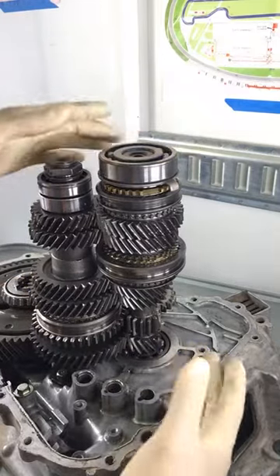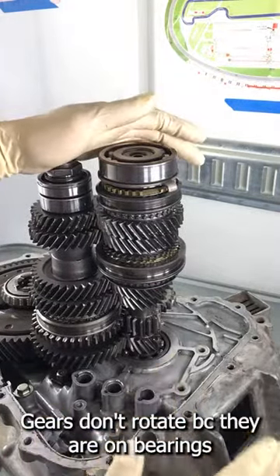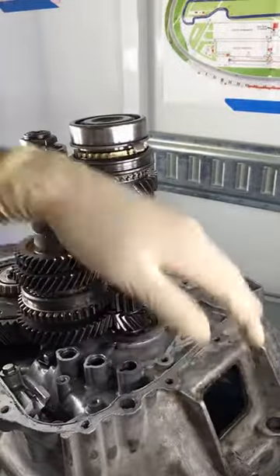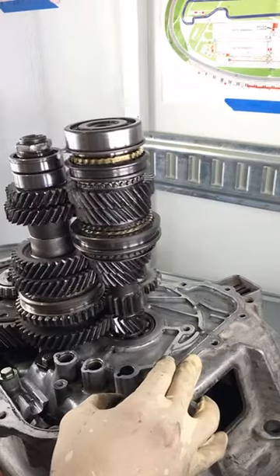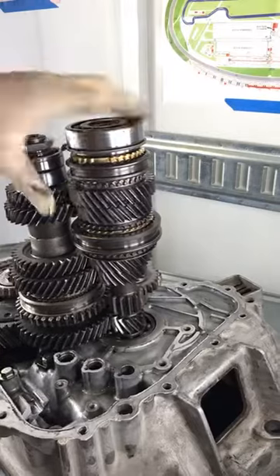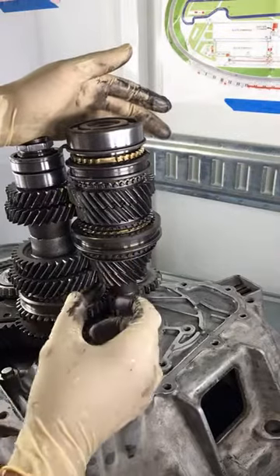The way the thing works is if I were to spin the shaft right now — if you're in neutral, the gears don't rotate. To prove this, I'm going to lift part of the transmission so I can reach my hand under, and I'm going to start rotating the main shaft. Now the shaft is rotating, and I can hold on to the gears and they won't move. The reason why is because these gears are not attached to the shafts, and how they eventually attach to the shafts is with the synchro assemblies.